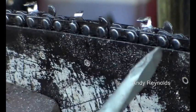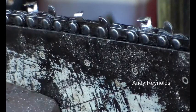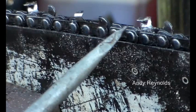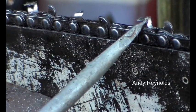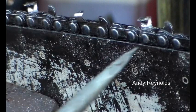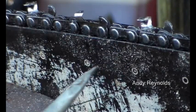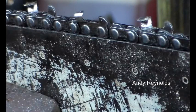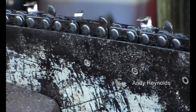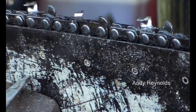I'm going to go around and maintain this chain again. Some people say it's sharp enough, but if this has done a tank full and been cutting a lot of ash or any timber really - ash is particularly hard - then it will have taken the edge off slightly, maybe imperceptibly. Spend five minutes and just sharpen it up again, one or two wipes and you're back to performance. The best way to reduce your environmental impact when using a chainsaw, apart from switching it off and not felling habitat trees, is to keep it sharp - you use a lot less fuel, a lot less oil, and you create a lot less noise.